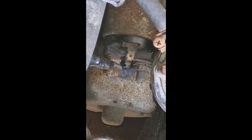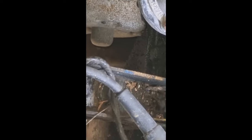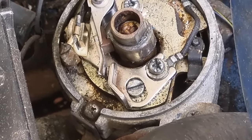That was what I was hoping for! By short-circuiting from one terminal to the other, we have power going to the starter motor, engaging the solenoid, and winding the motor over really well - it turned over great. There was also good spark jumping from the points at the same time. Let me see if I can show you that - I'll short-circuit the starter motor again.